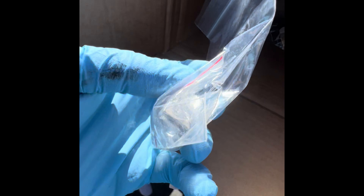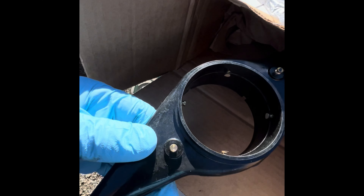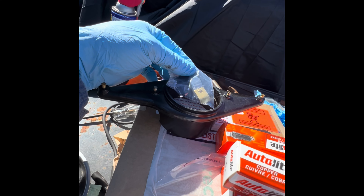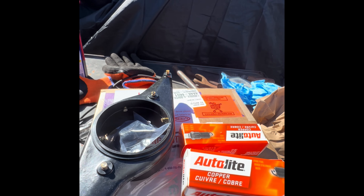That's what I was looking for — my new points. I've got my rotor. I guess I've got to gap that too with the distributor. All kinds of excitement. A new distributor cap. I think the rotor can only be about 0.025 thousandths — or whatever — from the contacts when it's turning, so I've got to make sure that's gapped right and file it down if it's not.